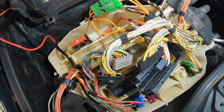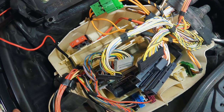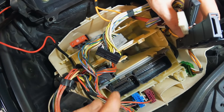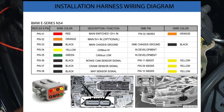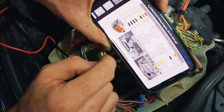This may get a little disorienting because Australian vehicles — right-hand drive cars — have the DME box on the left-hand side of the car, which is the opposite to the States. The front of the car is that way, the back of the car is that way. Here we have my decluttered, JB4-gone DME box. This car's actually got an MSD81 — but whether you're MSD80 or MSD81, they look the same. With the help of the instructions from Reflex, they do actually explain — down in the bottom section — where each of the connectors are and what each is numbered as, which matches up with the wiring diagrams from BMW TIS.